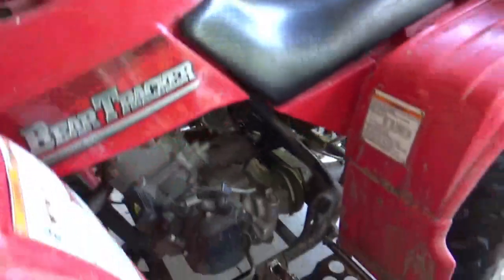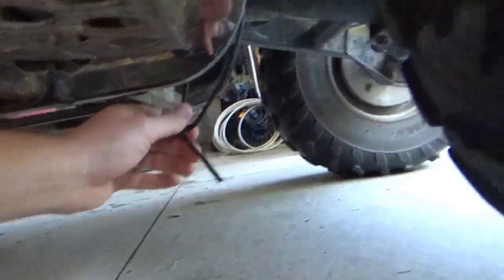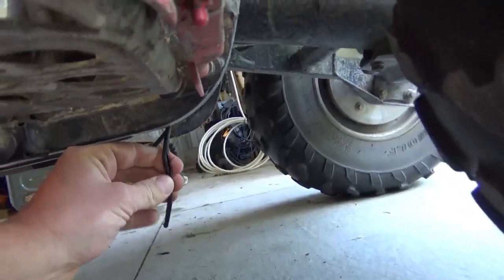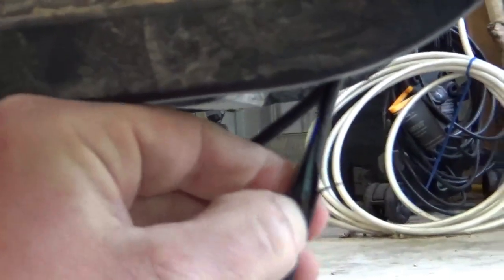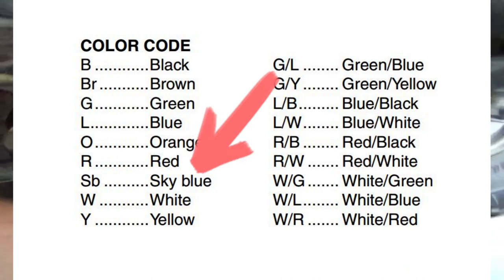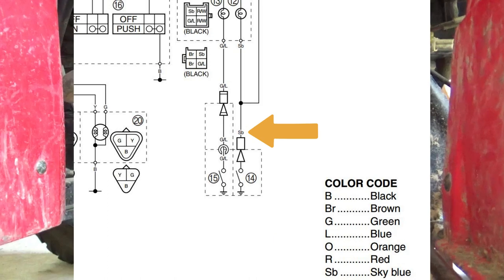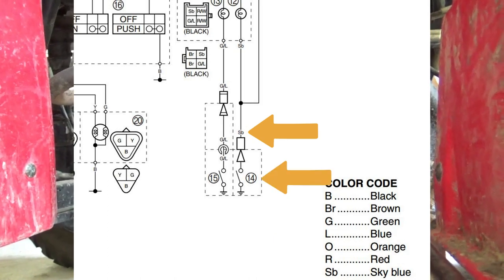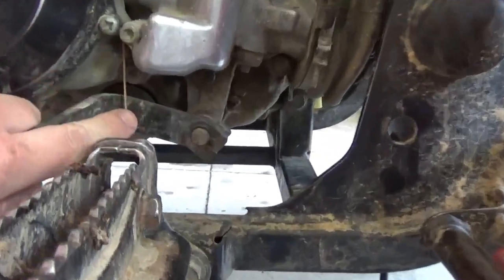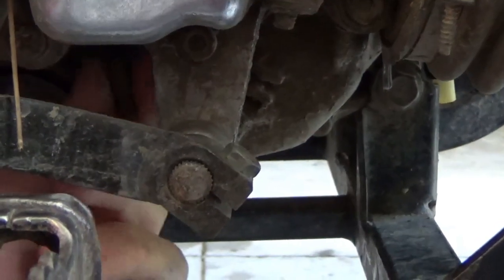So what I found here, looking around, some wires hanging down here. You can see on this one our wire color — it's blue, sky blue according to Yamaha. And when you look at the wiring diagram, it goes to the neutral switch. So that makes total sense with our two problems here. If you look behind the shifter right here, that's where that blue wire goes.